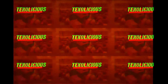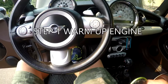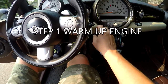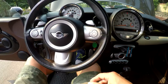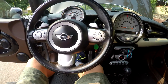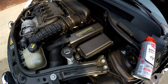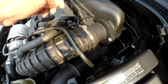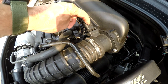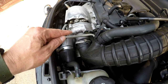So the first thing you want to do is take your CRC spray, lift the hood, and come over to where this hose clamp is. You have to loosen it so you can get your straw underneath and spray past your mass airflow sensor, which is right here. You loosen it, stick the straw underneath into the hose, and that will go directly into the turbo, which will spread throughout the motor.